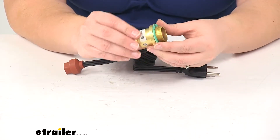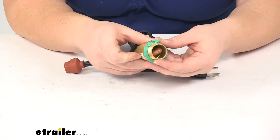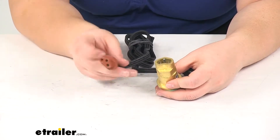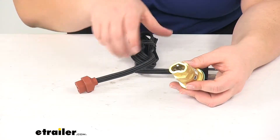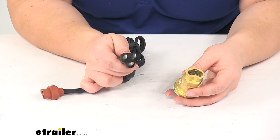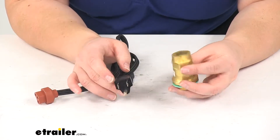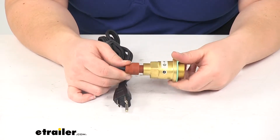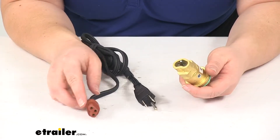This is going to replace that frost plug, that core plug in your engine block, and submerge in the coolant — you'll just thread this into place and it will stay there. Whenever you're ready to heat up your engine, you'll plug it into that removable cord. You can just route the cord through your grill and then plug into a standard 120 volt AC outlet to get your engine block heated up. That's just going to plug right into the other end of our frost plug there and it should start heating up right away.